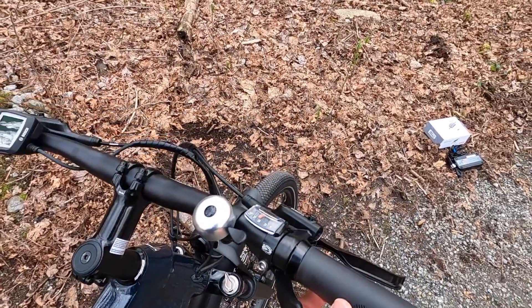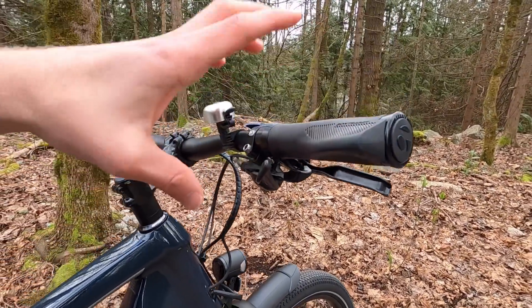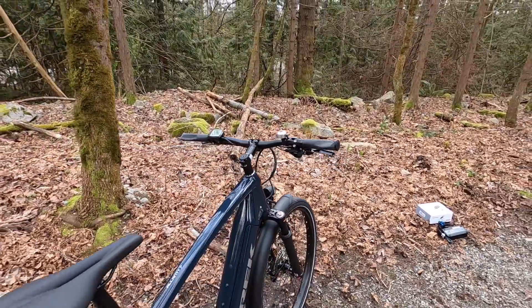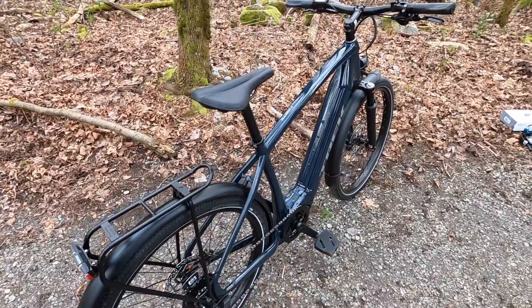Back up at the triggers — this is a two-way high lever: see how you can push it or pull it. And then there's a three-step low lever, so you can dump the gears. Be careful — yes, you have shift detection, but you don't want to overdo it.